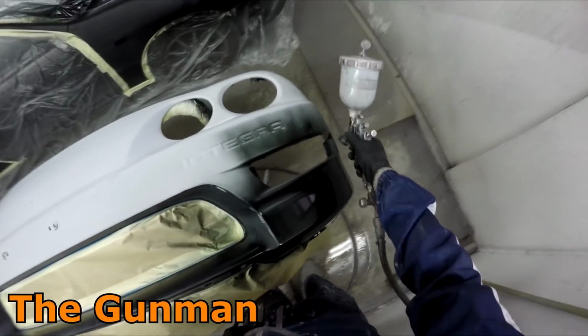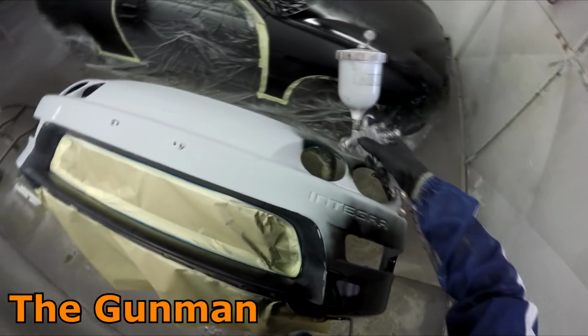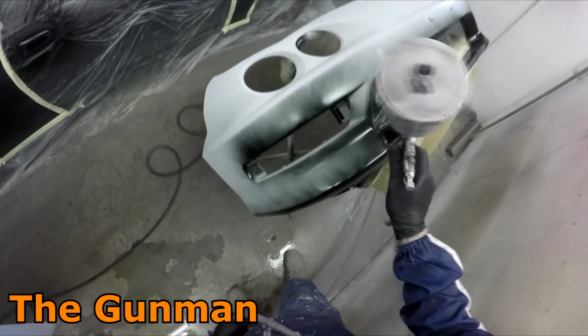And your pressure settings are sort of anywhere from 20 to 25 psi, give or take. You might find that in the colder weather the pressure's jumping up a little bit, and you might even need it up to 29 psi. Personally, I would think that's a bit high for this gun, but whatever works.